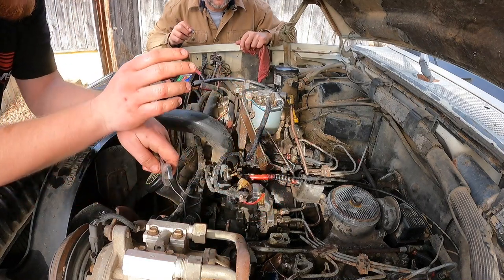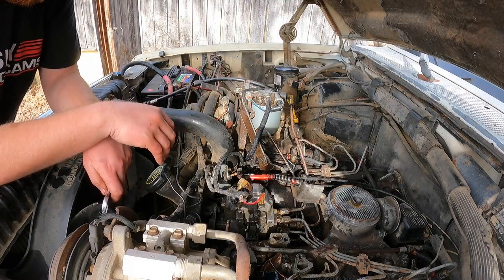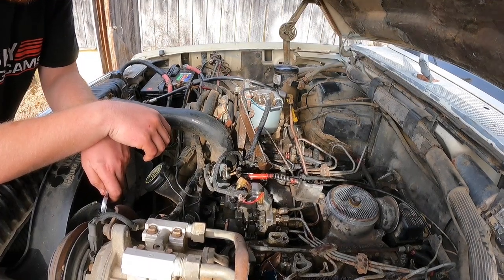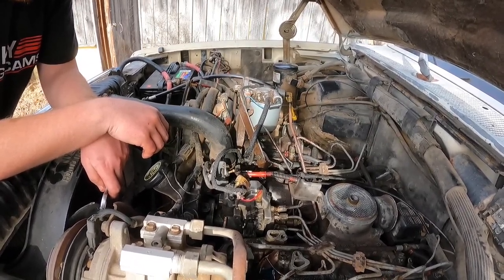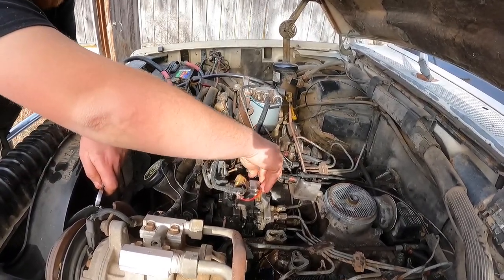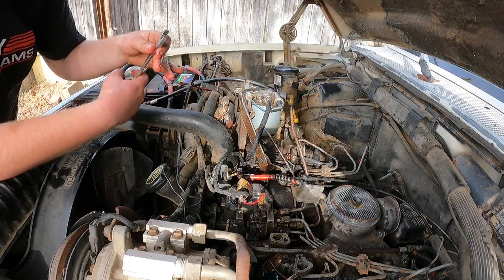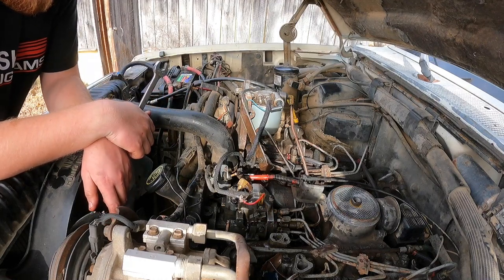All right. So, let's see if this works. We'll call that we were purging the air. Pre-flight checks. Come on, you're ready. I'm ready. I'll give the starter a break. Did we get fuel out of anywhere? Yeah, we got fuel out of the return. So the pump's full. Okay. But nothing out of any injectors? No.